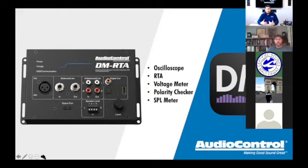If you're connecting via Bluetooth using the option port, you'll be using a tablet or smartphone — not a laptop. If you're using a laptop, use USB. I personally prefer USB because it's instant with zero latency. Bluetooth is convenient but has a little delay, and when using something like the RTA, USB is just faster and cleaner.